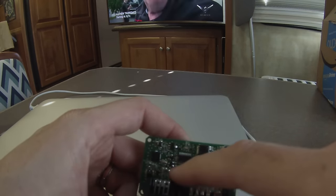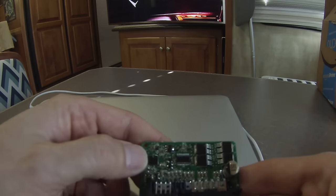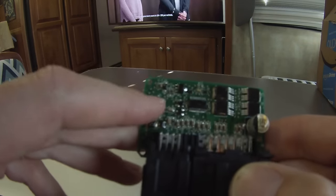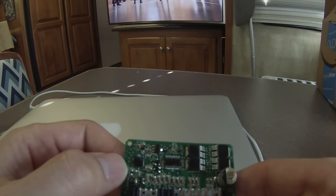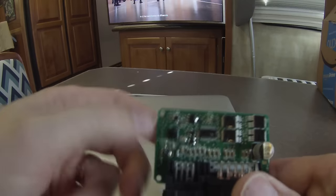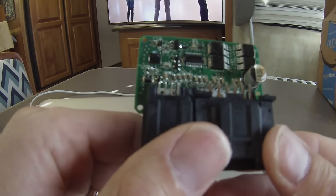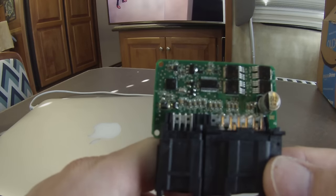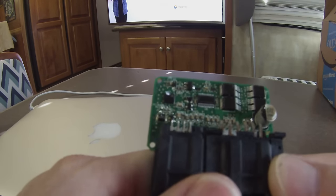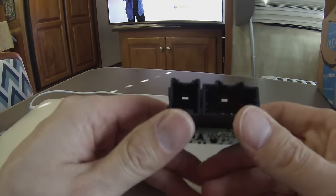This thing is a little over-complicated if you ask me. Looking further at what I believe is the LIN controller, there's a good chance somebody could tie into it — most of the pins aren't being used. If it's an Atmel chipset, you could theoretically reprogram it so instead of talking to the BCM, it talks directly to your switches. But that's way out there, requires a lot of reverse engineering, and whether we'll get to that point we'll see.